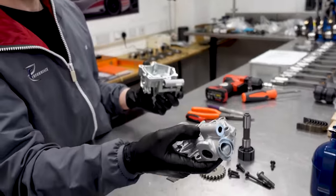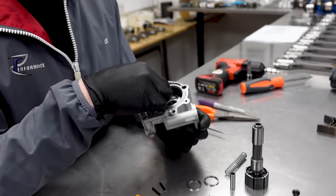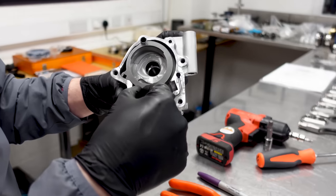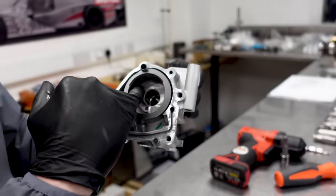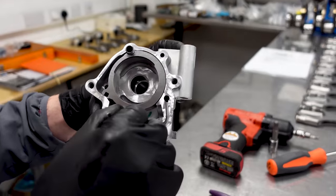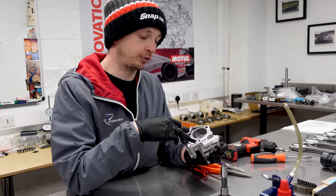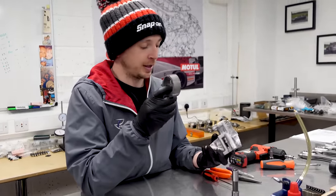That controls max pressure, and then this little dealie controls the sweep of where the pump sits. So if we put that back in - can you see here, that half moon, which is what feeds into the outlet of the pipe? Can you see how it changes the exposure? Yeah - so it opens it up earlier. So it's pump timing basically. And that's oil pressure controlled. The higher the RPM and the more oil pressure you create, you can change pressure and ultimately change the flow.